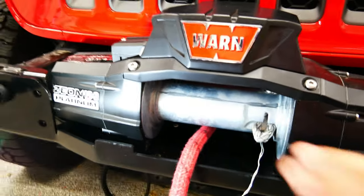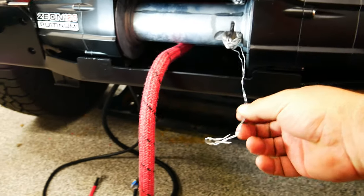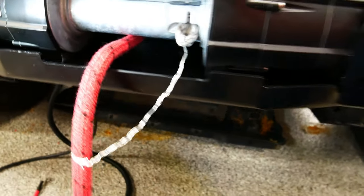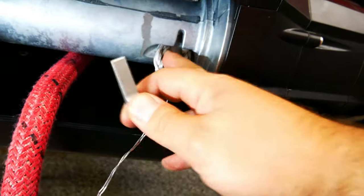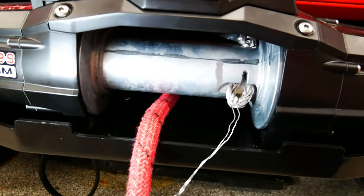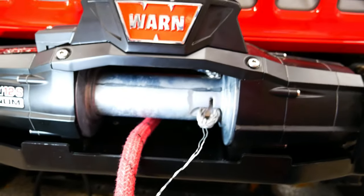Alright guys, if you get a winch with synthetic cable you have to install it yourself; if you get a steel cable it's already installed. You take this wire and thread it through the loop, stick the wire through the small hole, and use leverage to pull it out. Then remove the wire and jam the key in with the lobe facing inside, making sure it's completely in the loop and touching the metal. Yank on the rope side to jam the key in — then the winch line is fully installed. I don't have the winch wired yet so I'll do that as the last step.